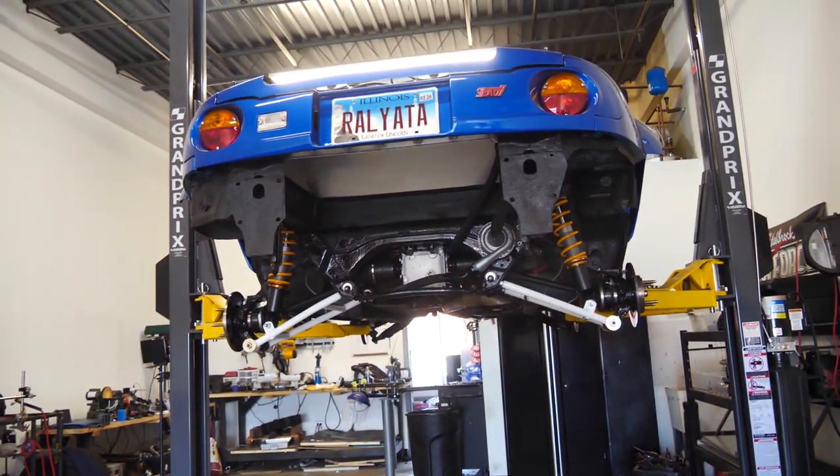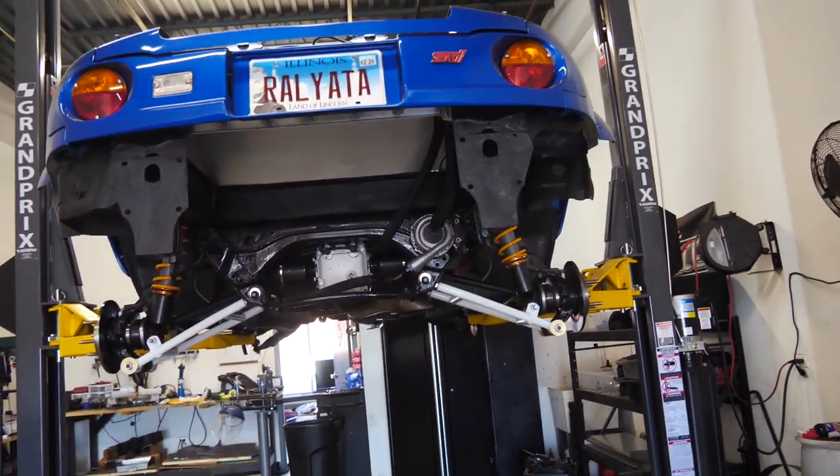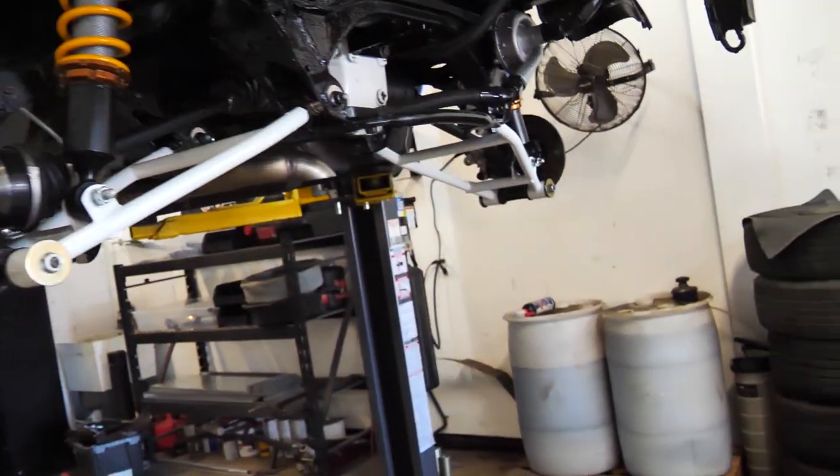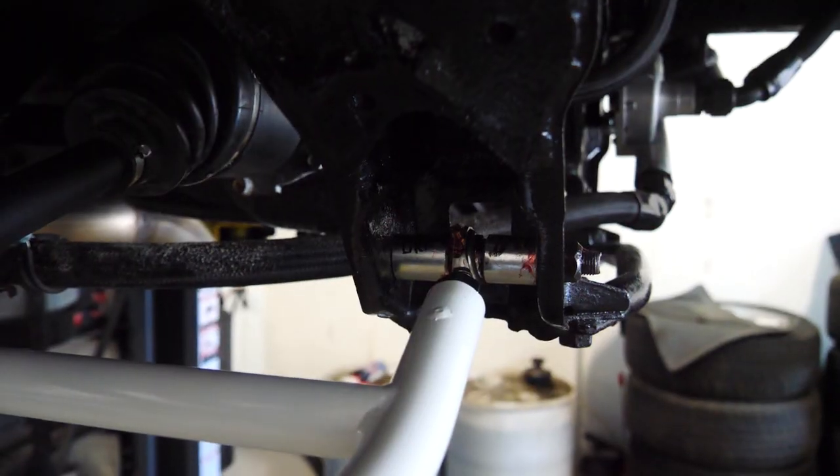Control arms, rear suspension - actually all the suspension is now assembled. We can put the wheels on and lower it down. I'm pretty sure you all noticed I had stacked a bunch of washers to space the heim joints in the middle of the subframe on the Miata - that's obviously sketchy. So I fabricated - just cut up some solid steel bushings to the right size, so it's a nice piece of solid metal. Much better. I also greased up the heim joints with a grease gun. So let's put the wheels back on, drop her to the ground, torque down the bushings, and start adjusting the alignment.